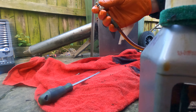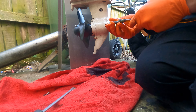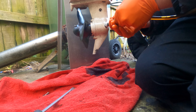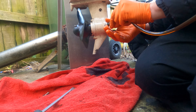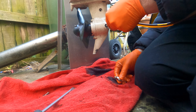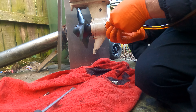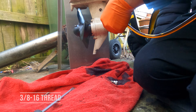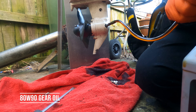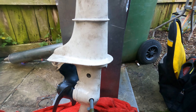I've got the gear oil here and we're just gonna screw it into the lower unit using the adapter. It fits — actually for small ones like this it's easier just to hold them. It doesn't need the adapter — it's an imperial thread for that one. We'll just pump some oil in until we can see it coming out the top.